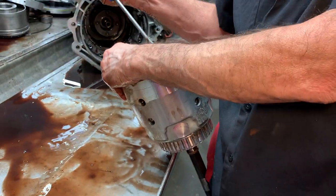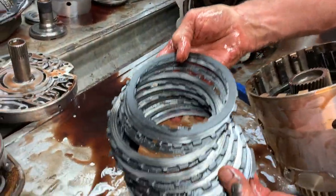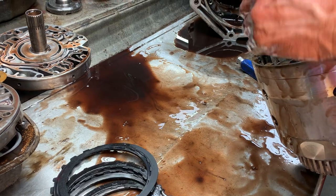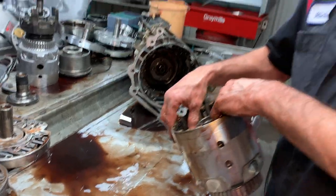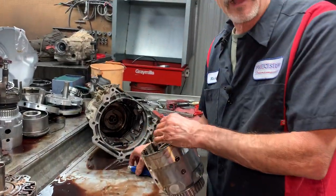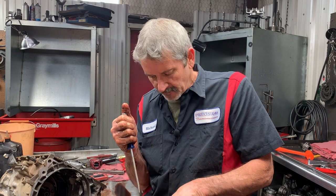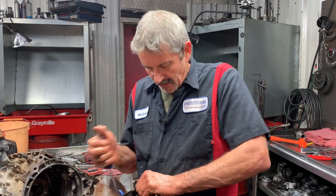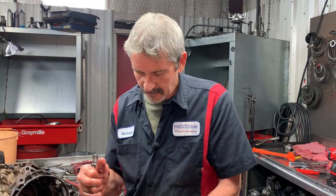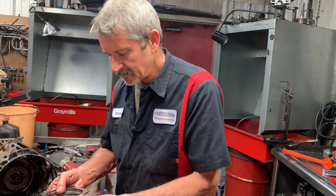We knew the 3-4 clutch was going to be burned up and it's just totally cooked - there's nothing left. It's got the six-clutch pack in it with all the load springs. That's why when we get done with this unit and put it back in, we're going to put a pressure gauge on it and watch pressure rise in every gear. We're going to make sure this computer didn't lose the ground circuit to raise pressure on the 2-3 shift to apply this clutch - because this is the number one killer on this tranny. We've got a video out there with Trent changing the wiring and adding the wire to change the ground circuit and repairing the computer inside the car.